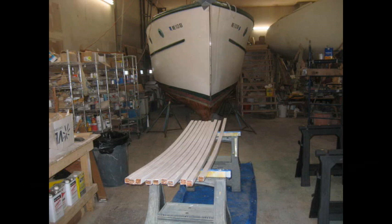At the end of the boating season in late October 2014, we hauled the boat out and took it directly into a workshop run by my friend Hank Hinckley. He had agreed to let me have space to do the cabin house rebuild. A couple of weeks before haul out I had started work already, since I knew I was going to be building a completely new cabin house. The first step was to laminate all new beams for the cabin top. You can see them here — I brought them over, set them out in front of the boat right after we moved it in, and started painting them. Here they are after one coat of paint. I decided to paint the beams before installing them because I really don't like painting over my head.